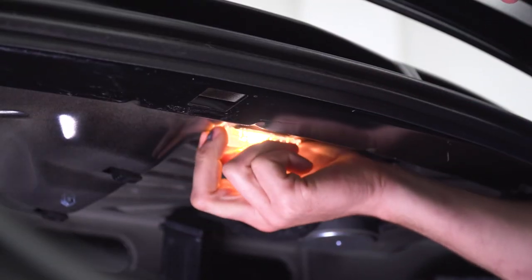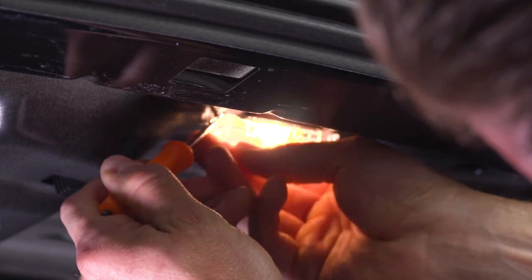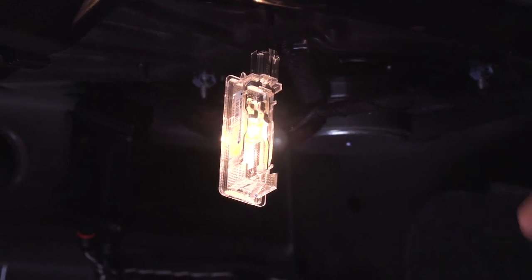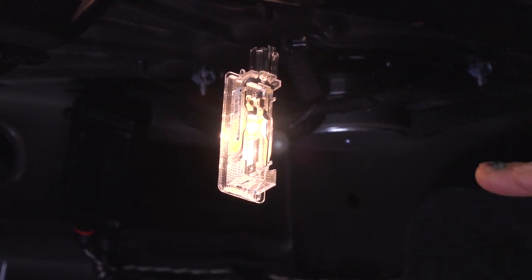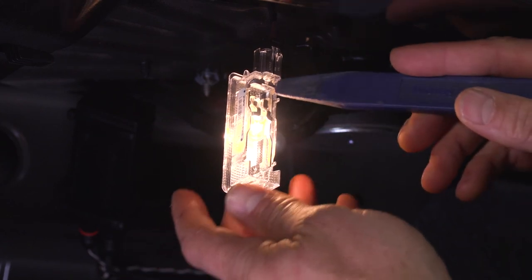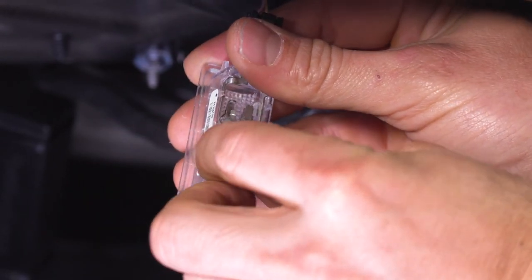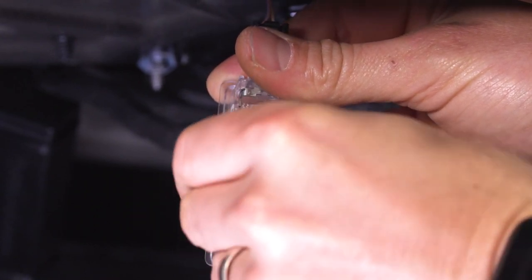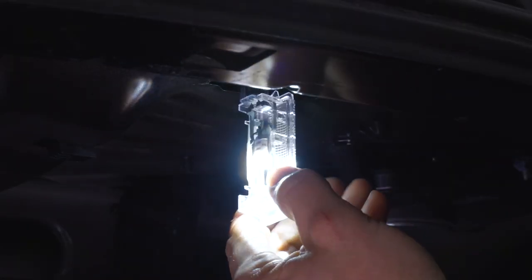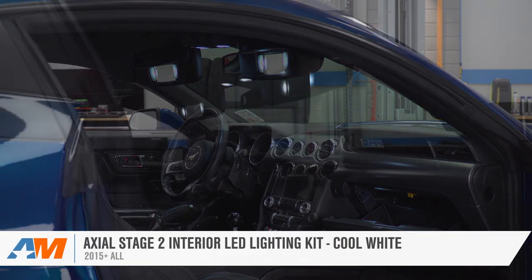Sometimes you should be able to slide this over and pull it down — ours is being a little stubborn, so I'm gonna get my flathead in there and help release the clip. With our housing released from the rear deck lid, now we can remove our factory bulb. It's hot, so definitely don't use your fingers. Also don't use anything metal because if you touch the two contacts together, you will pop the 10-amp fuse. So we got a plastic pry tool to remove the bulb, grab your new Axial bulb and insert it in reverse order.